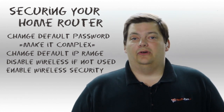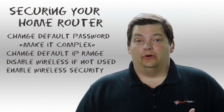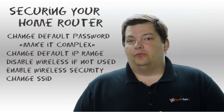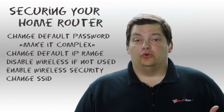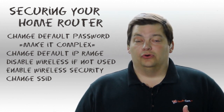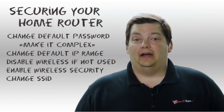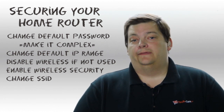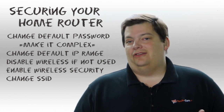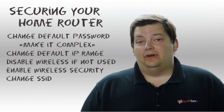The other thing is changing your router's default name, or SSID. When a router comes out of the box it has a default name — Linksys for Linksys, and each brand has their own. You want to change that for a couple of reasons. Beyond security, if there's more than one Linksys in your neighborhood, your phone could connect to your neighbor's router instead of your own. If you rename it, you know which one is yours. I wouldn't use your last name or address — that's too much information — but you can call it anything you want. If you have security on it, the name itself is less critical.